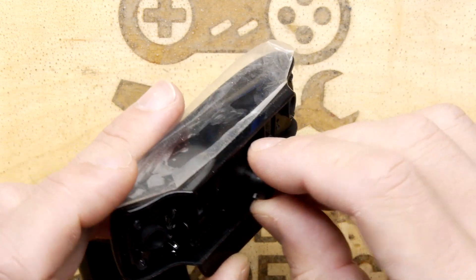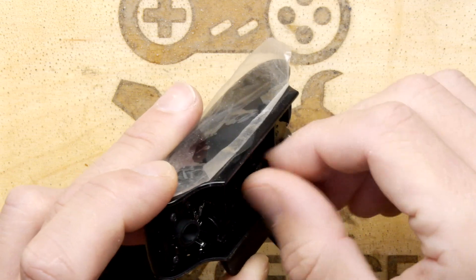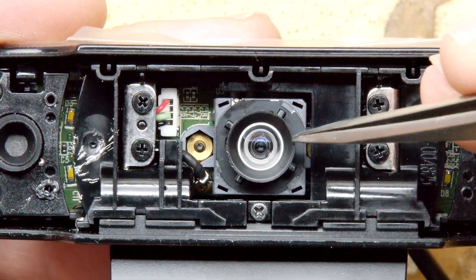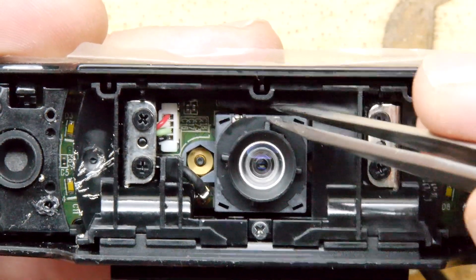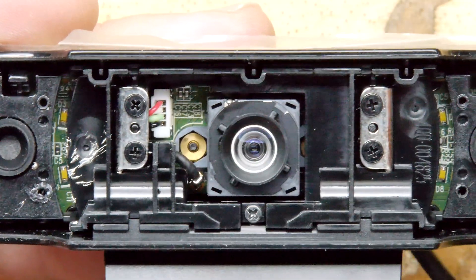What you should do is hook this all back up to your machine and be a bit gentle — this is all floating because it's part of the autofocus mechanism. Then keep turning the lens inwards, sit back, turn it a bit more, and in your software set it to the maximum telephoto — the maximum zoomed out — and make this adjustment. That'll be the maximum zoom-out you want, and then wind it in slowly until it's sharp how you want it.